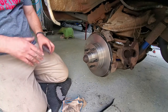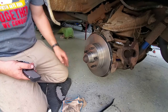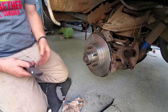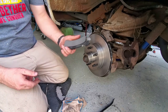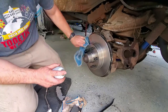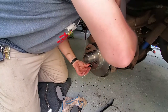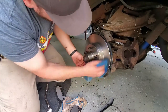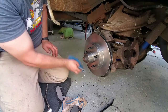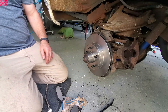We got all this together. It does seem a little tight — I did it the same as I did the other side. The inside is just a little bit looser, and we'll give it a little bit of time to see if it breaks in. Got new brake pads for it. This one seems a little rougher than the other side — maybe this one's got a little bit of surface rust starting from sitting.